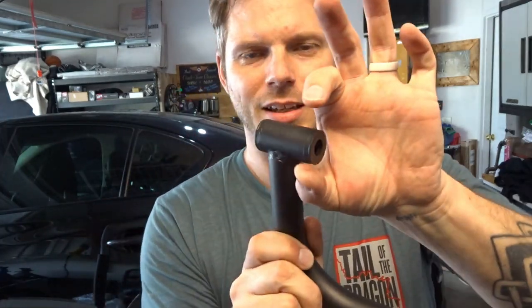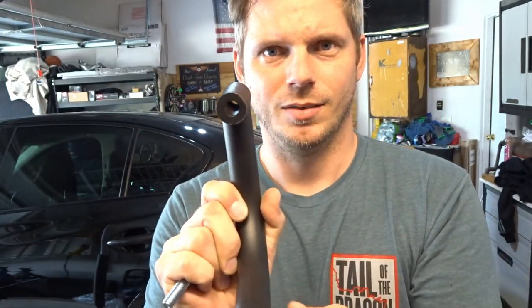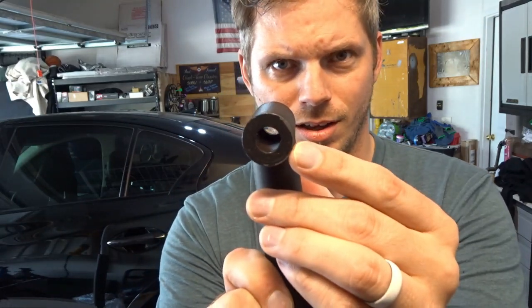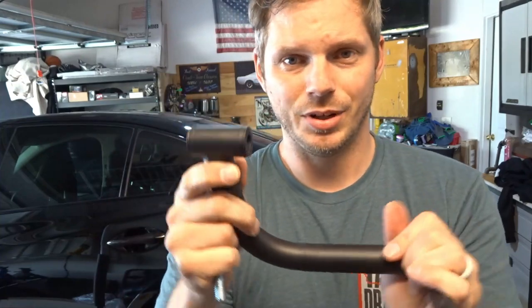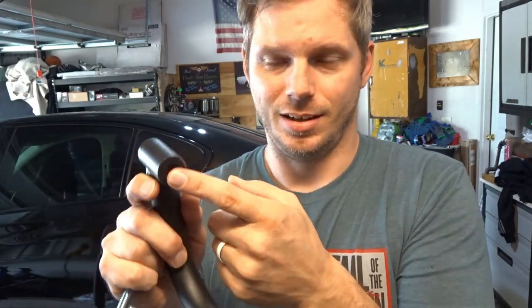I mean, what is this, maybe an inch and a half, inch and a quarter, something like that. I think it needs something as large as a fender washer, like maybe a 2-inch face, rather than just a small point, because that rear diff is flexing a lot, especially if you're really launching and you get some good grip. Talking about the VR30 guys, if you're making 450, 400, 500 foot-pounds